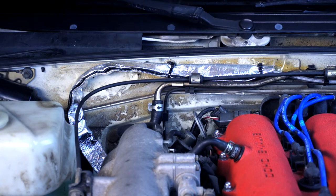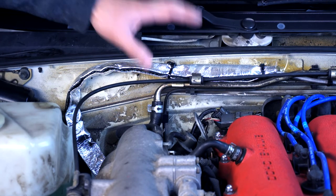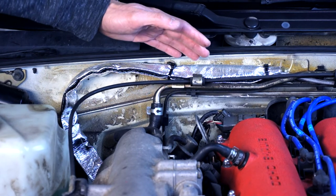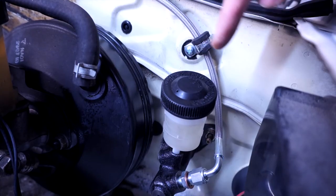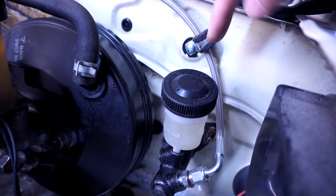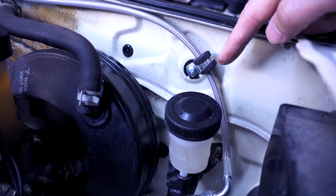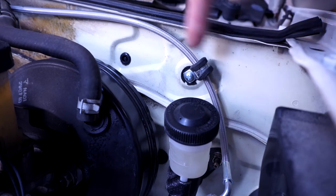For final finishing touches, I received this thermal wrap from Amazon today. I've put this on the clutch line — it's always nice to have a little bit of thermal protection on hydraulic lines, especially if it goes close to the engine or the exhaust side. Since we're doing the job, it doesn't hurt to add this. And last, by the clutch master cylinder, there was a factory plastic clip holding that hard line. I've replaced it with this rubberized wire holder — I've used these before in the aluminum radiator upgrade episode. It's not snug in this holder; it's just meant to locate the line along this path.